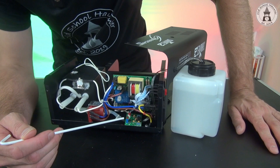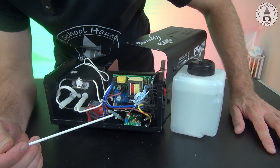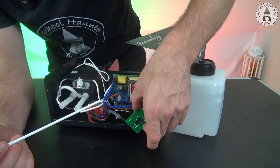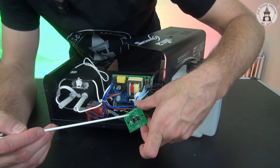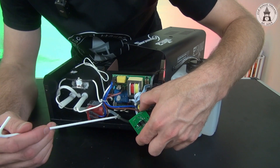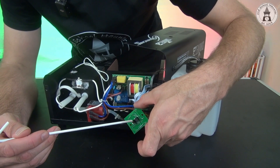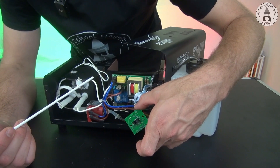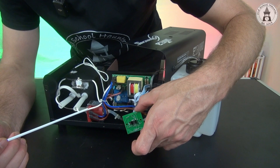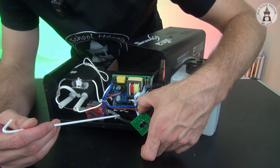You will see you have to be careful when removing the screws — it's a little bit difficult. Please be careful so you don't damage something inside. I removed the screws before I started recording, so let me take it out. What we have here is a so-called flow sensor. The tube with the fog fluid runs through the sensor, and the sensor measures the flow of the fog fluid within the tube. This is the reason why the machine stops working when you have air bubbles inside the tube. Imagine if you have an air bubble in between the sensor — the sensor will report to the machine: "Hey, you don't have enough fog fluid," and the machine will shut down for security reasons, which is a good safety feature. But this is why the machine stops working, and why you get it back to work when you remove the air bubbles.